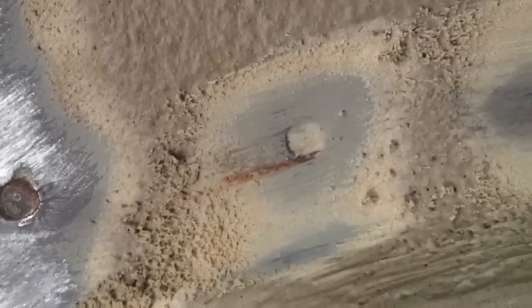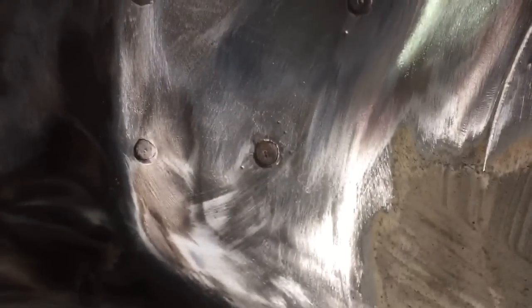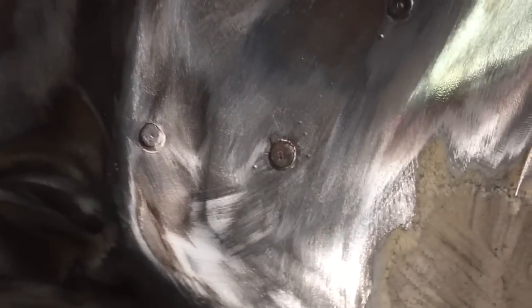This was all underneath the sealer, couldn't see any rust earlier. And then just one quick swipe of this seam sealer and you can see rust coming out of this spot weld, which also suggests that this spot weld has got a crack around the outside. I've started center punching some of the little hairline cracks coming out of that spot weld. This one's opened up, now I've center punched it to locate the drill to drill them out.